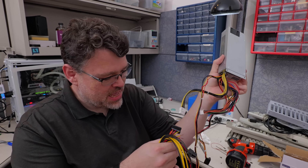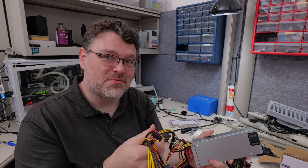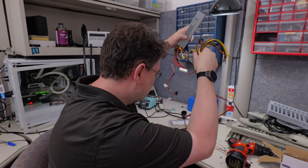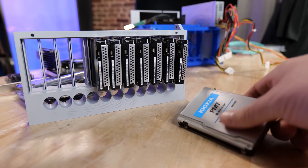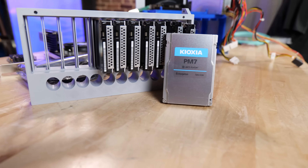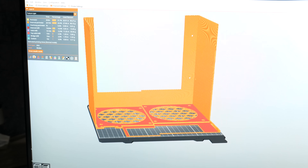The base power for this? Seven watts. And I've got 96 gigabytes of Crucial memory in there with four built-in NICs. Now that power usage is completely blown out of the water when I add mechanical hard drives, or even our Kioxia PM7 drives, along with our 100 gigabit Mellanox interface. But seven watts as a floor is fantastic for an idle system that's just hanging out on your network, not necessarily doing anything.